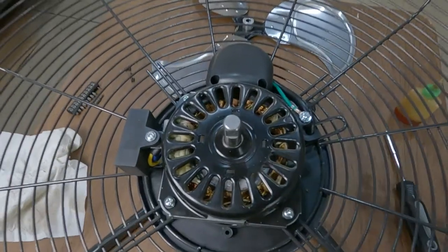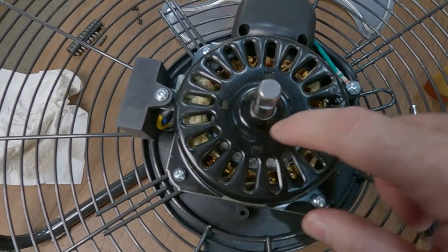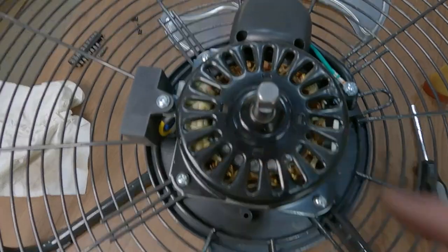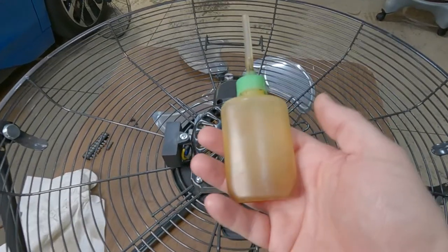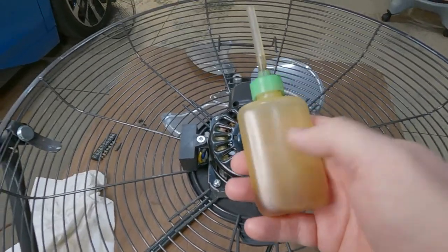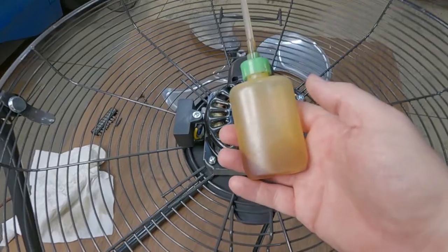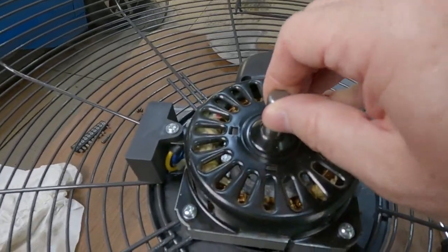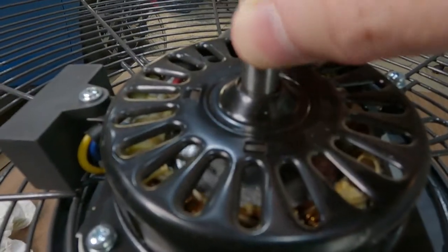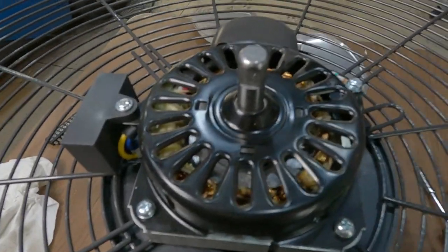We've got the shroud and fan off, now we have the shaft exposed and you can see the little bushing that we're going to oil-lubricate down around the edge there. I'm going to use this — it's just called electric motor oil. I got it at a hobby shop back when I raced radio control cars; it's just amazing stuff if you have a squeaky bearing. The shaft, once you get it exposed here, if you pull on it you can see that it goes up and down a little bit to allow the armature to find the sweet spot in the magnetic field when it's running.